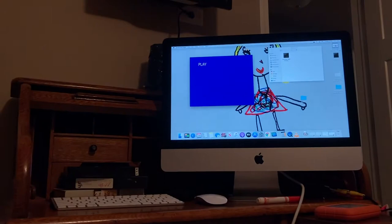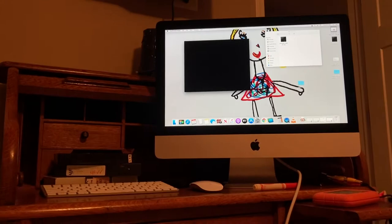The head cleaner tape did not solve the problem. Next, I tried adjusting the tracking with a screwdriver — I don't have a remote for my VCR, but there's a screw you can adjust that affects the frame and tracking. That also did not solve the problem — no change on the screen, just a black screen still. I made sure to return those set screws to their original position since I only turned them a small amount. You can see the blue screen says 'play' — there's a little snow, then it goes black.